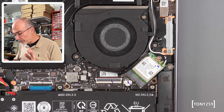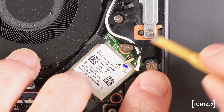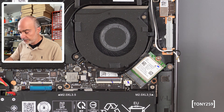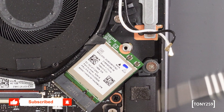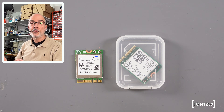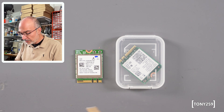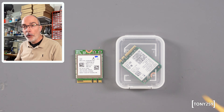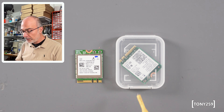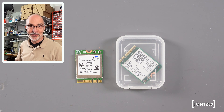Now let's remove the aerials — they are quite fragile, so hopefully I'm not going to damage anything. And finally I can go ahead and remove the actual Wi-Fi card. Before replacing it, I want to make sure it's physically OK. I'm hoping that the keying of the Wi-Fi card can't be mixed up, so if my replacement is physically identical, it's going to work. And as a minimum, even if it's not working, it's not causing damage.